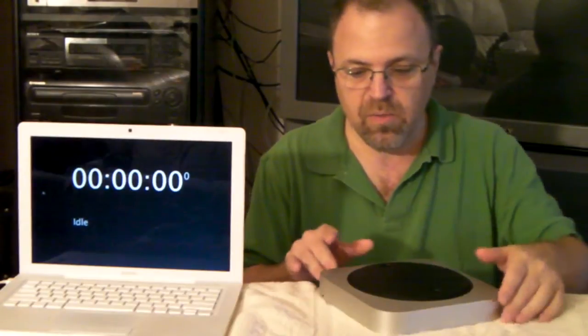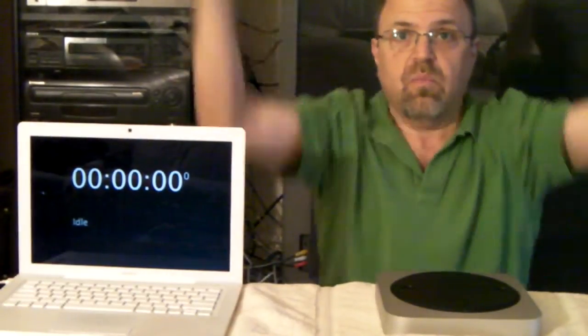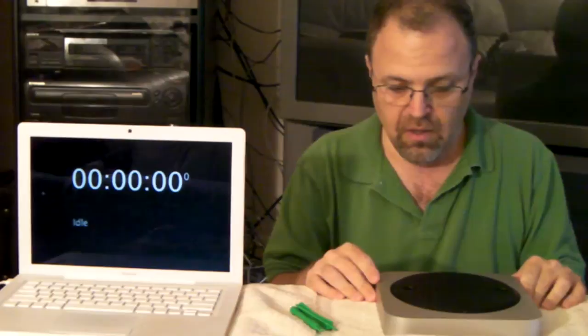Here's my Mac Mini. You spin the wheel five degrees or so to pop the lid off. I'm right-handed; I'm going to move over a little. I'm going to take the RAM out of the packaging and put it there as prep. I have spudgers on hand in case I need help getting to the lower one. I don't anticipate needing them, but it's like Fear Factor computer repair. Wish me luck. Enjoy the narration.